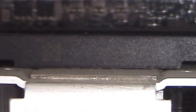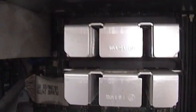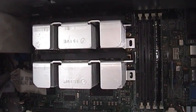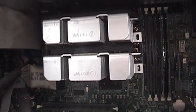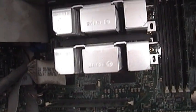Dual Pentium 3 733 megahertz processors, although you couldn't tell that by reading them. Trust me, the print is there. You can just barely make out this QR code-like structure that's been printed on the processor, but I guess that heat and time have served to fade those. I would imagine that they're Coppermine processors. I don't know what the highest end microprocessor supported by this system might be, but if I end up keeping it, which might be a little bit iffy, we may just get to find out somewhere down the line.